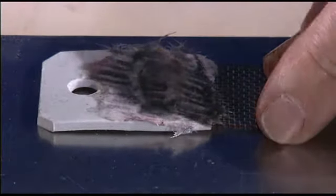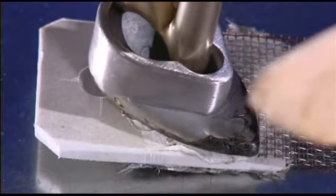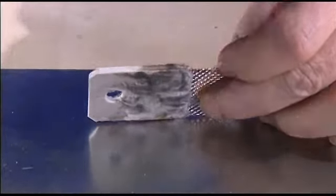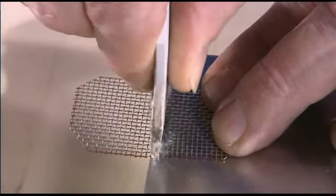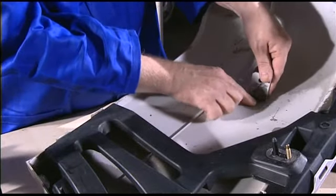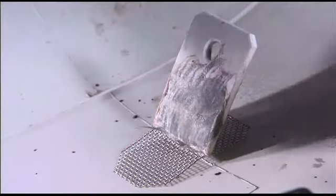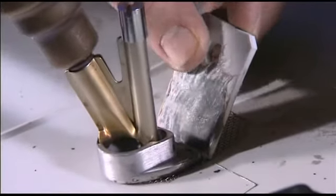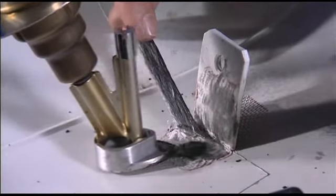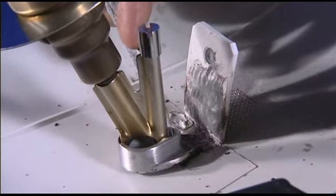Now for the back of the lug. Fold the protruding stainless steel gauze out at right angles. Mount the lug in the required position and weld both sides into the bumper. Tip: bend the lug slightly to the other side — it makes the work easier. When this step is complete, it's time to use the multi-thermoflex welding rod again. Melt it in, smooth the edges and let it cool. Finished.